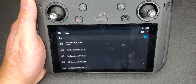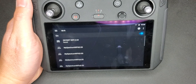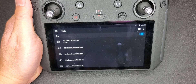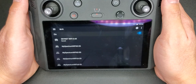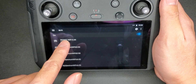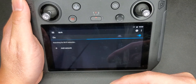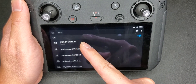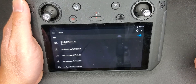Some of you might not be able to do this, but you might have to go out in public with your controller. What I did was use one of my smartphones and enable the mobile hotspot. I tried to connect the controller through that and it worked. To do it: go into Settings, turn on WiFi hotspot, then go into the WiFi settings on the controller and refresh it — press it off then on. Your hotspot, like mine called 'Samsung S10 Plus WiFi Hotspot,' will pop up. Type your password and connect.